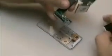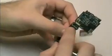At this point, we're going to want to attach the LCD back to the main board. The clip should still be clipped because we just pulled it out. So flip that open, line up that ribbon cable with the connector. It should easily slide into place. And just clip that clip back down. Place those clips on either side of the top of the back panel. The LCD should just sit into place.